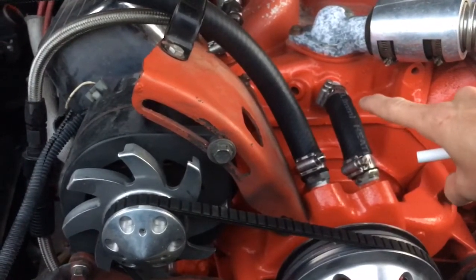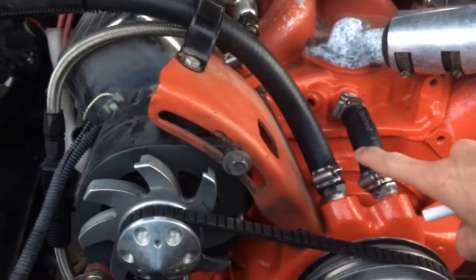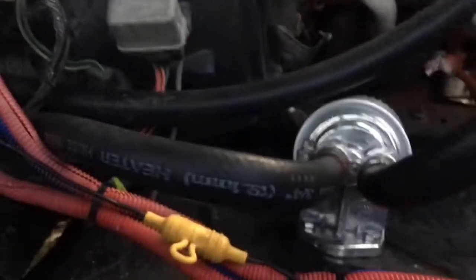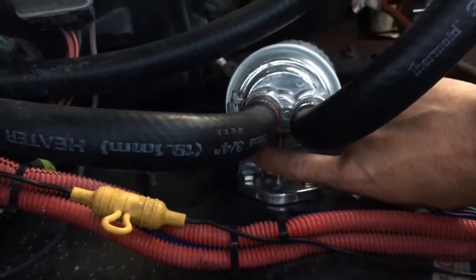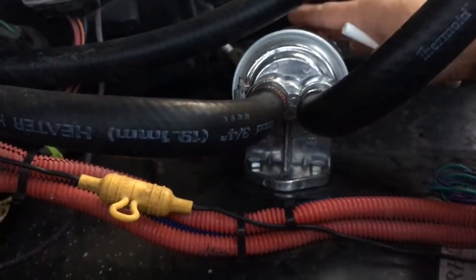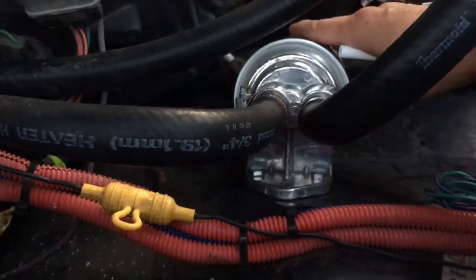This water from the manifold comes to the pump, and so does this line. What I had done — and here's my mistake — is that this front line right here, I took it to the inlet side of this off-mount filter. I knew there was an issue because every time I'd start the truck and warm it up, I could never get this filter warm or I never had any heat out of my heater core.